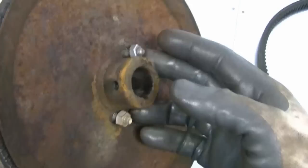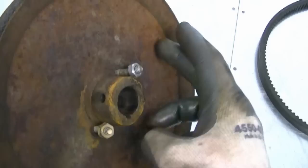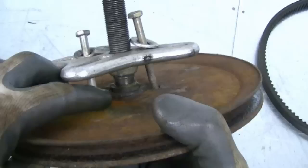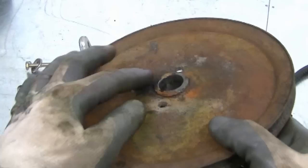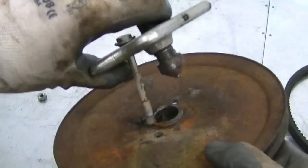The only way I was able to do it was by drilling two holes in the pulley. You're not going to damage it just by drilling two holes like that. It's really important that you drill the holes close to the adapter here, because if you drill them too far out, what's going to happen is the pulley is going to bend when you go to pull it off. And because this is where it's stuck on the shaft, that's where you need all the pressure when removing it.